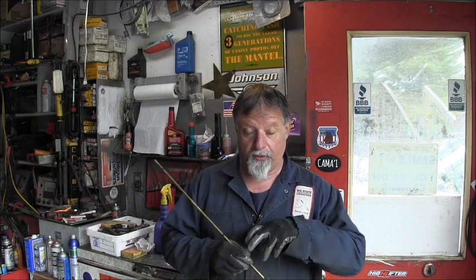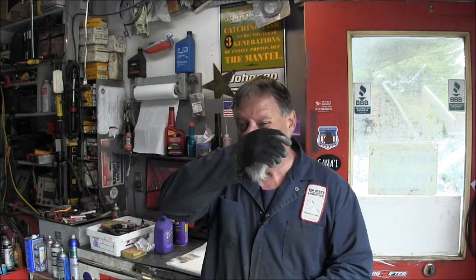It does run better after a good carb cleaning. When I blew compressed air through the needle seat after I took the float needle out, and then through the emulsion tube, some salt, literally hard dry stuff, came up and hit me in the face. So there was a little yuck in there, and it shows. It runs a lot smoother, idles a lot smoother.